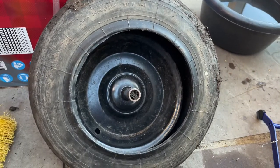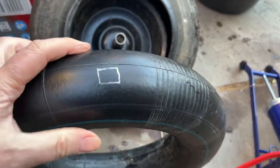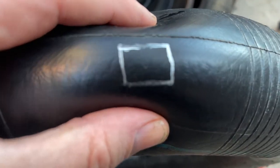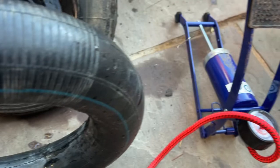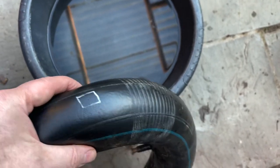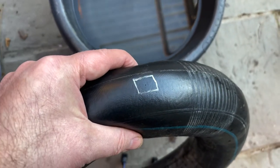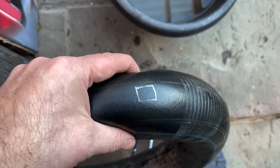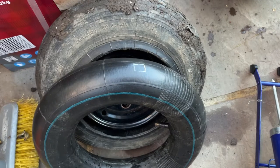I've unscrewed the tire from the wheelbarrow, brought it back home, managed to get the inner tube out, and I found the hole - I've put a circle around it. How did I find that hole? I used a foot pump to pump up the inner tube once I got it out, then put it in a bowl of water, gradually dipping each section of the tire in while inflated. You get air bubbles coming out and that tells you exactly where the hole is. Wiped it off, had a quick look and sure enough there's the hole.